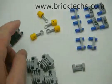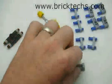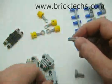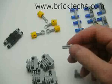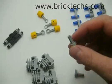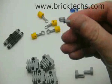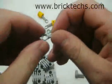The next thing I want to talk about is the pistons. The object of the rotary engine is to get all four pistons on one pin. The pistons are built to put two on a pin, but they're not built to put four on. So to do that I actually had to make some modifications. This right here is a regular piston connector — a connecting rod, that's what they're called.